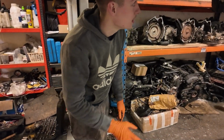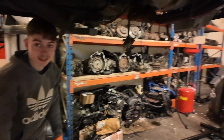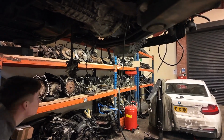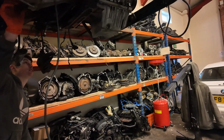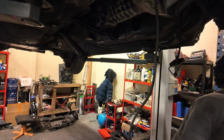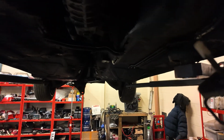Bolts up to the M54 absolutely fine, and it's a lighter flywheel. Is it single mass? Single mass. Same as my one. I know a lot of drifters that put that on the M52 and stuff. But obviously not with this gearbox because of the rotation. It looks very small anyway, and because of the age, I don't know how long that would hold. Yeah, and with the radiator you've got a lot of space around, isn't it?